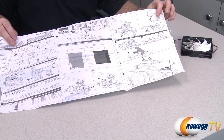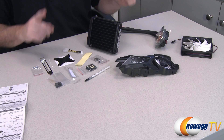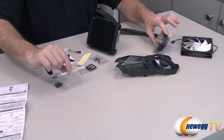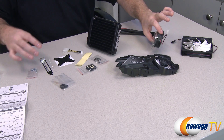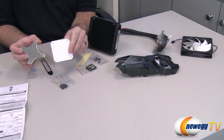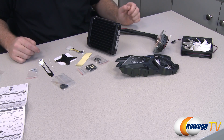Also over here is the full list of accessories. Bear in mind that there is thermal glue and thermal paste and you should not get those mixed up. The thermal glue is more permanent — that's in this little packet right there. The thermal paste is right there and that's to apply between the copper block and the GPU itself. You have an assortment of screws for attaching the shroud to the cooler and also for various assembly procedures. There's also a little card that's a layout for the bracket so you can make sure you're lining up the holes appropriately, plus an extra PCI bracket for the back of your case with some ventilation holes.